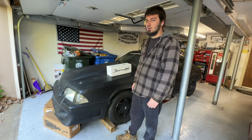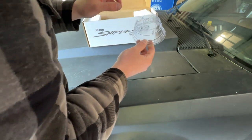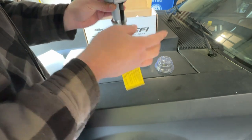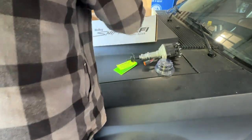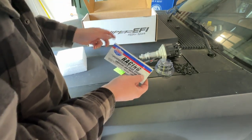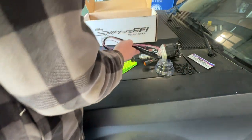Let me show you what comes in the box. We have Holly's plastic phasing cap for getting the timing set up, the actual distributor — again the Hyper Spark 565-341, the one-plug normal small block Ford distributor — an MSD-style distributor cap (Holly owns MSD), gear break-in oil or you can soak it in normal oil depending on your motor's stage. Since this motor is already in the car and running soon, I'll just use normal oil.